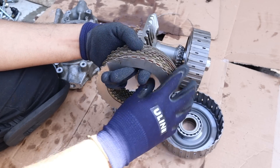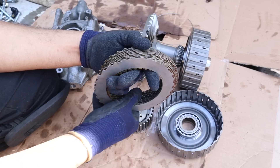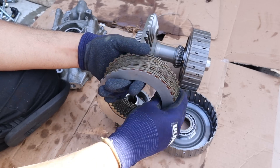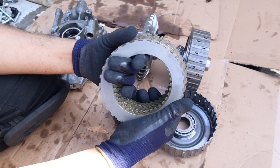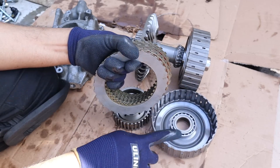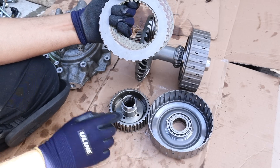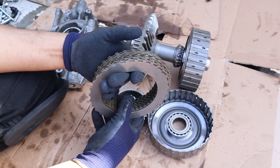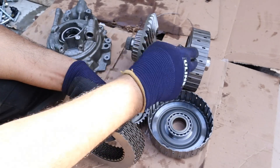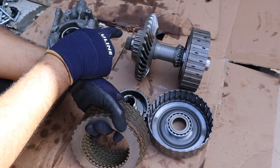As you're driving along, these clutches are allowed to slip relative to each other — the inputs on the outside can keep rolling while the wheel is relatively stationary or slipping against it, depending on the wheel speed difference as it rolls along. However, if you apply pressure and lock this up, this entire thing becomes one piece: whatever is externally splined — the input — is now connected to the internal spline which is the output, and now you're going to have power transfer between these two. There are variations — it's not always completely locked up; you can have a little bit of slip between the clutch plates, allowing torque split. You can also apply both clutches all the time, which gives you a complete 50/50 torque split.